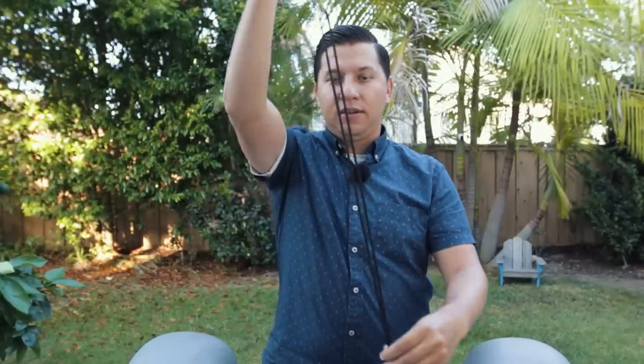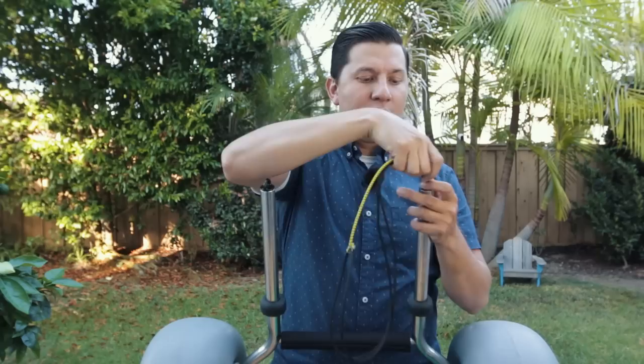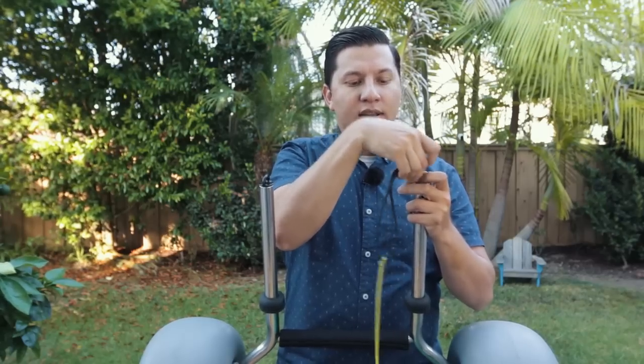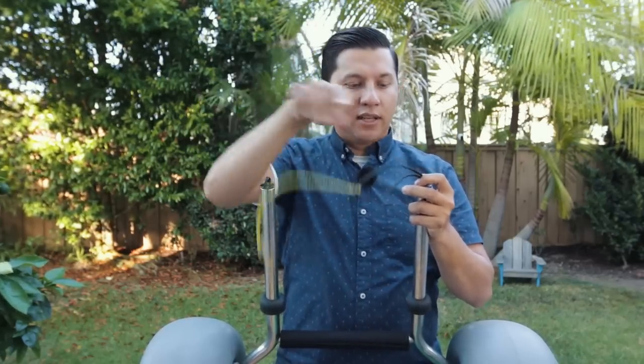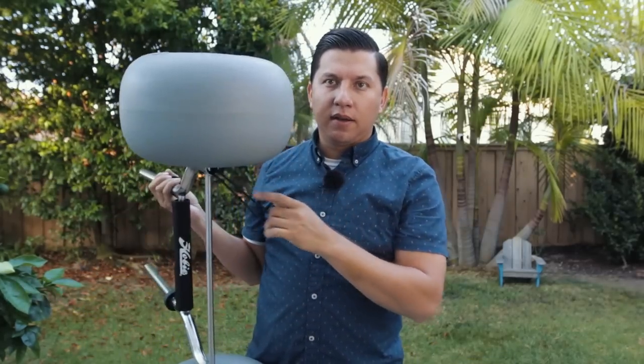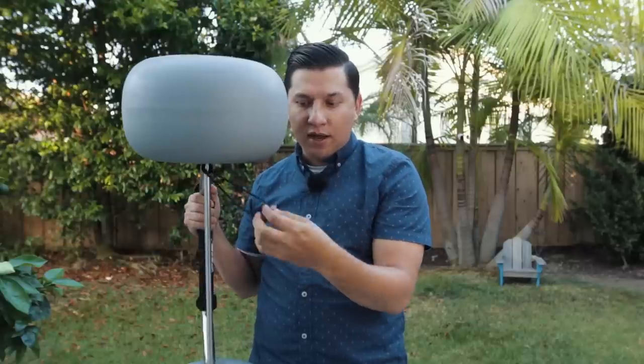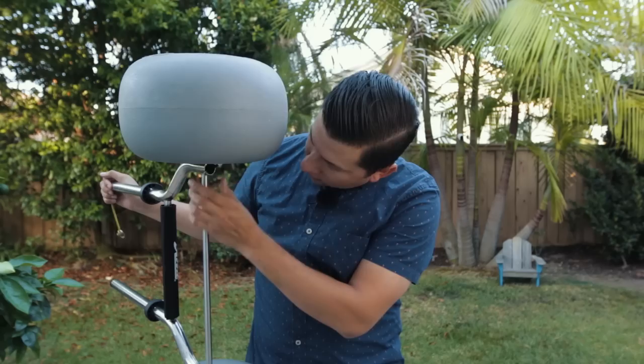So what I'm going to do is put a bungee that fits through that hole this way. It's a paracord that's crimped to a thinner bungee. I'm going to put these paracords through the hole here, pull them out the bottom, and tie it down to the bottom — that way I can adjust how much of this bungee sticks out. I put some paracord through there in a loop, and it's coming out of this bottom hole where the old bungee was tied to. The axle's there, so I'm going to put a knot here so it gets stuck on the axle on the way up. Once we pull the actual bungee from the top, it's going to pull all the way to the end. I'm just going to tuck it in there.